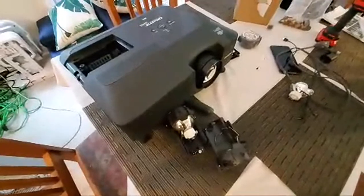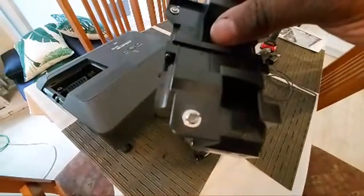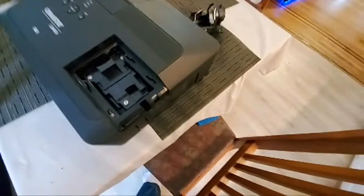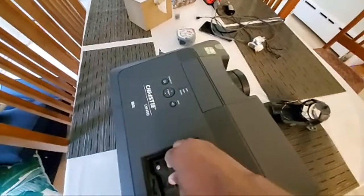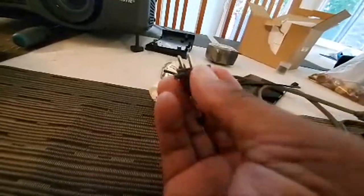It could be hitting against something, but it's supposed to fit without a problem. This is the original one — I had to slice the screws up top because they got stripped and I had to convert them to Phillips. The original should just drop right in and connect perfectly. The eBay lamp I had to struggle to get in, which means something around the housing's power supply connector was messed up. Once I cut all the housing off, I was able to put the bare lamp in and it went in perfectly — so it's a defective housing.